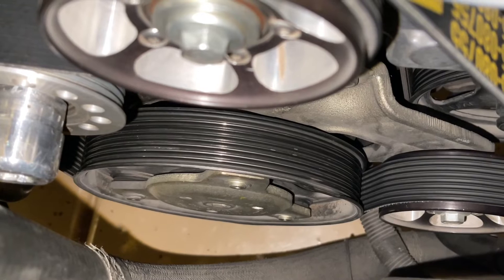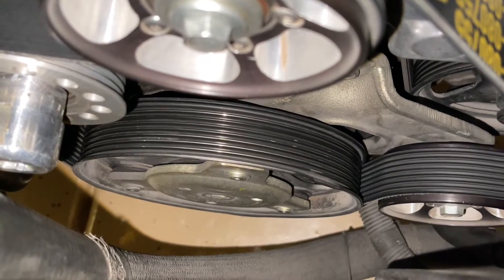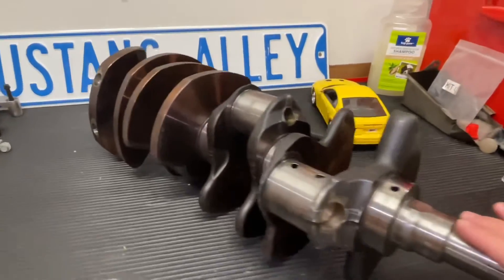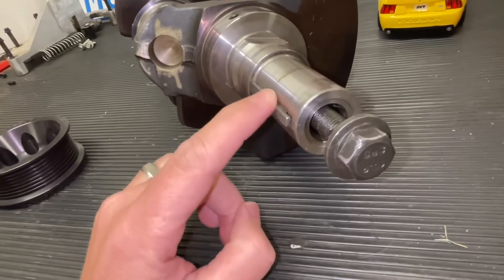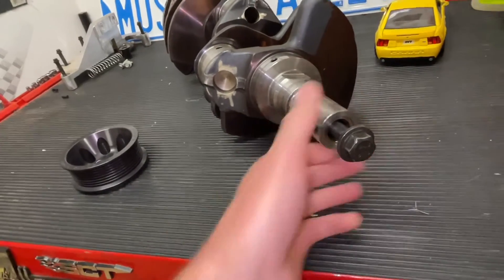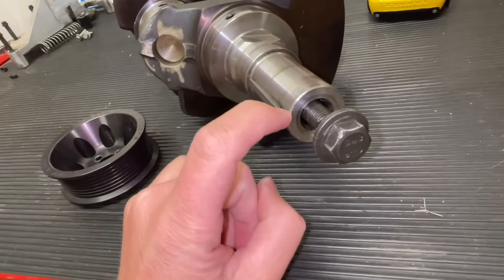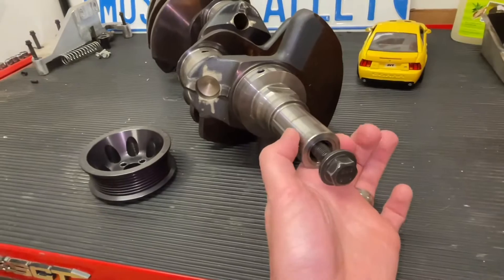You want to keep that caged system that helps support the crankshaft so that you don't snap the snout. Here's an actual 03/04 Cobra crankshaft — forged, 8-bolt. If you look at the very nose of it, this is the keyway. The oil pump gear rides right on this, the inner crankshaft pulley rides on that, and the outer pulley is connected to it. It's all riding on that little keyway. As the crankshaft spins, all that force from the bigger lower pulley relies on that keyway. When you have a huge blower and a lot of pressure spinning right here on the crankshaft, you can snap the snout.